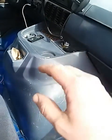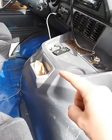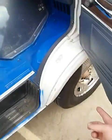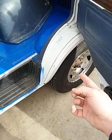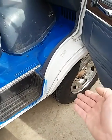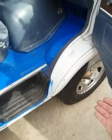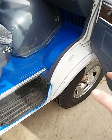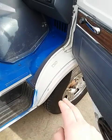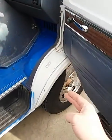So after I did that, another 24 hours went by so I could let the gasket sealer seal, and I added my fluids in. We drove it. Worked plenty fine. And then I found out that my tires are not the correct ones. Well, now they are, but the ones that they had on the front were 255/70 16s, and they're supposed to be 245/75 16s, 10-ply, not 4-ply. And I'm really glad that we did not drive on those original tires, because I also thought my power steering was going out, but it turns out it was just the tires.